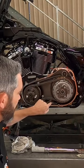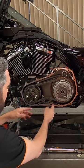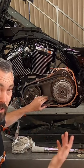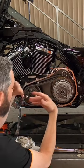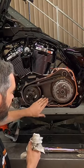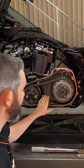But this design from Harley is actually very, very clever. It is spring-loaded, as you can see. It ratchets up this ramp and holds tension on the chain, but the beauty of it — there's a little detent on it, so when it gets to a tight spot, it will actually press backwards and allows it to move. So it does have some movement on that. So if it is on the tightest spot, it can go back the other way. Very, very good design. And again, guys, I have never seen one of these fail.